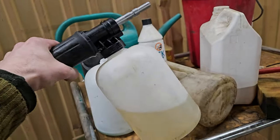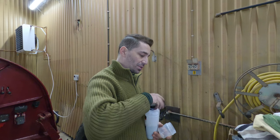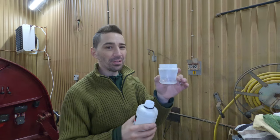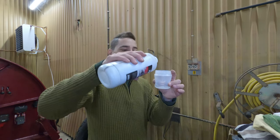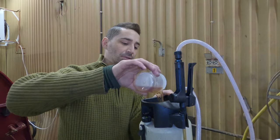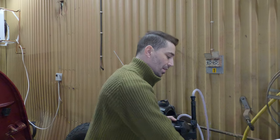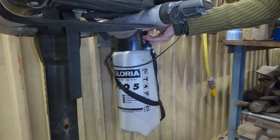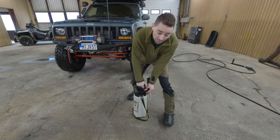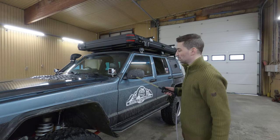You can obviously use the sprayers that connect to jet washes if you've got that system at home. Anyway, let's get into this. What we're going to do is put 50 milliliters of Pro Nano Concentrate into this little measuring cup here. It's got measurements on it. I'm going to put 50ml in, pop that in the sprayer, and then put a litre of water in. So it's 50ml per litre. I'm just going to pump this up and then basically just start spraying it on.